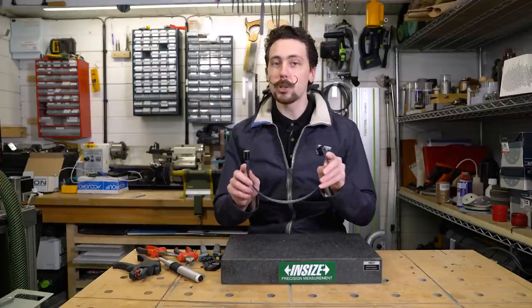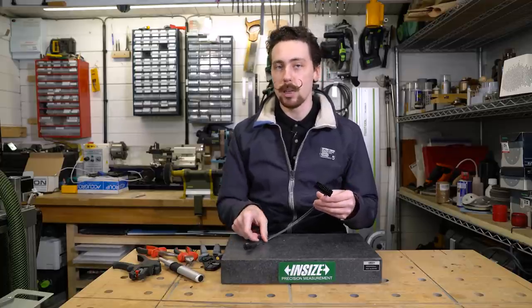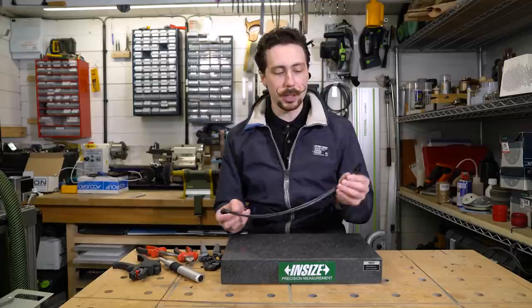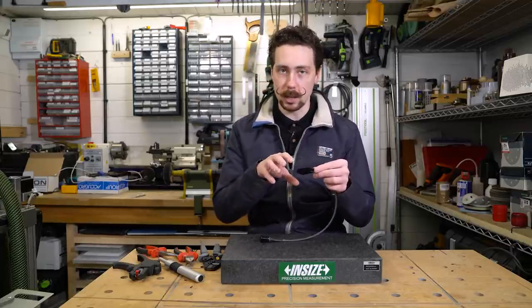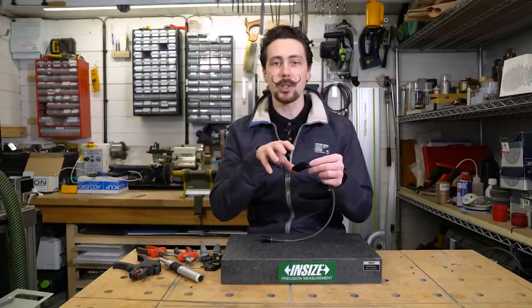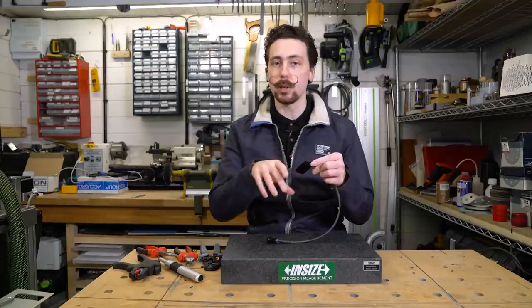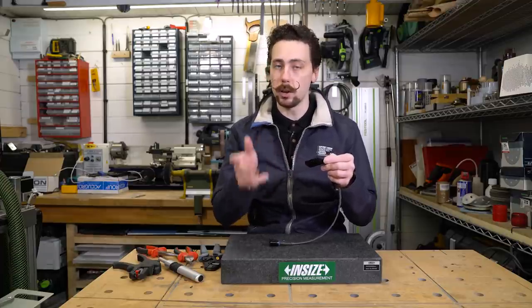Obviously, I've made this using all the tools that I use on a regular basis for making cables, and if you don't have all of these, there are a few methods that you can use that don't require everything. Firstly, instead of making the wire completely from scratch and having to crimp all of the connectors, you can instead just use some of the wires that already come with a set of extensions. If you buy some really cheap extensions online, or you have a spare set somewhere already, you can always just use one of those wires.